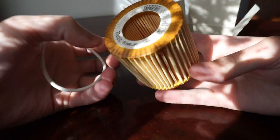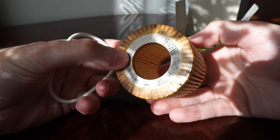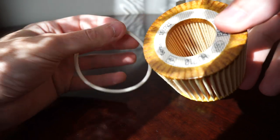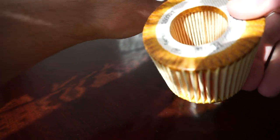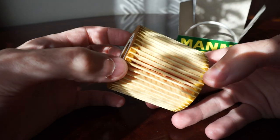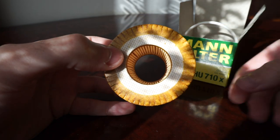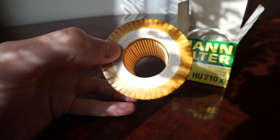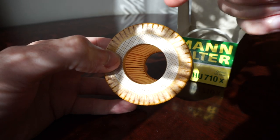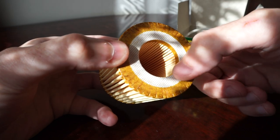This filter is made entirely out of paper and does not have inside the cylinder a rubber part — similar to a rubber gasket — in order to allow you to insert it more easily. If you buy a Mann filter and install this oil filter in a rush without taking your time, you will risk breaking the actual paper filter because it will go in very tough.